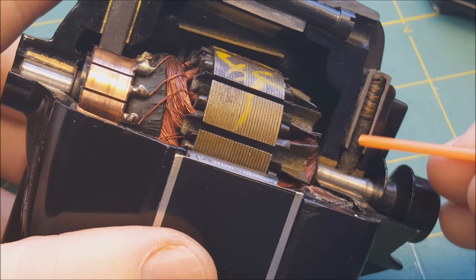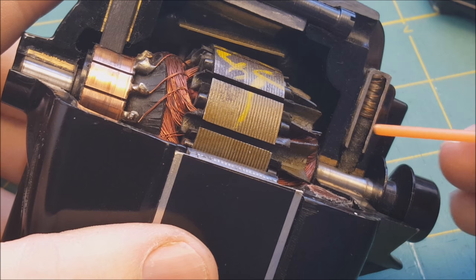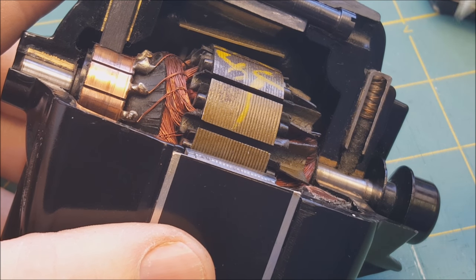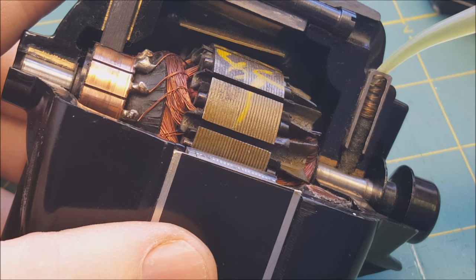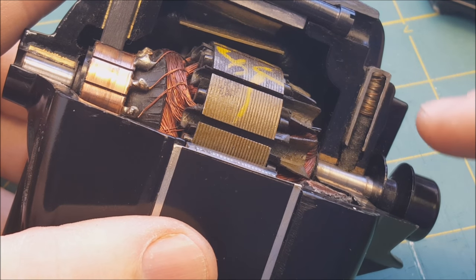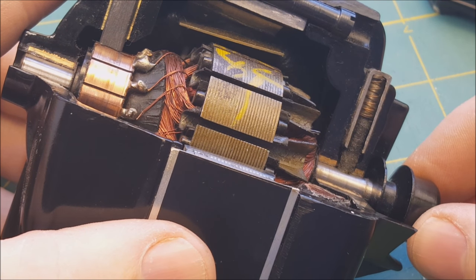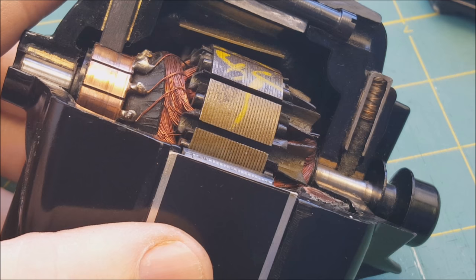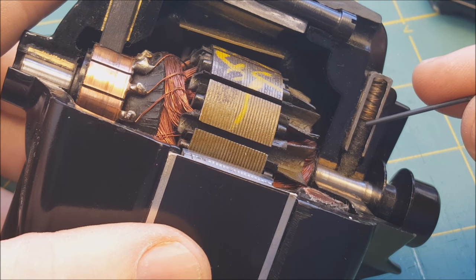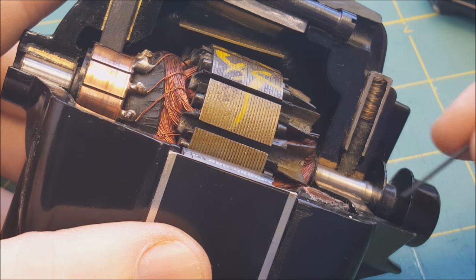This piece here is a felt wick. How this motor is designed — when you put lubricant in the motor and you fill up this space here, as you're sewing, there's some warmth generated here from the shaft in the bushing. That will cause the lubricant to slowly work down through this felt wick, and that's what lubricates the shaft.